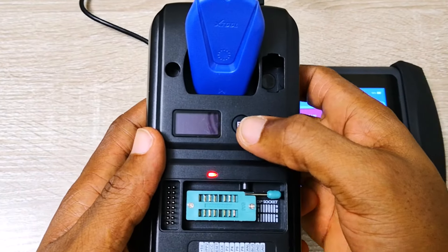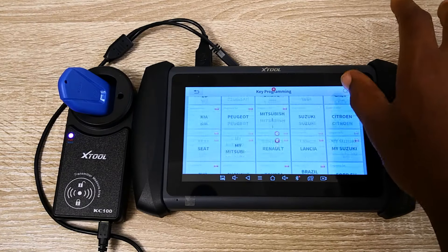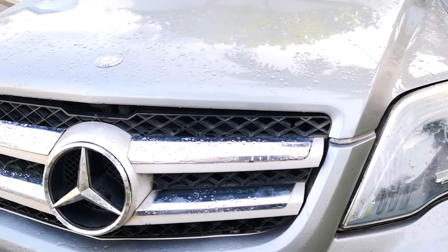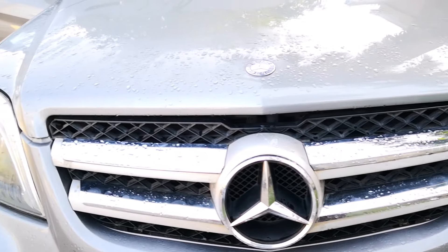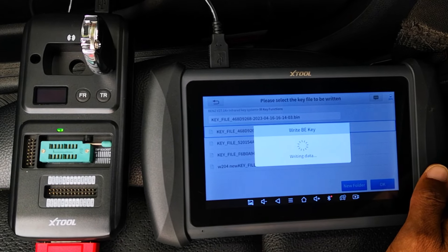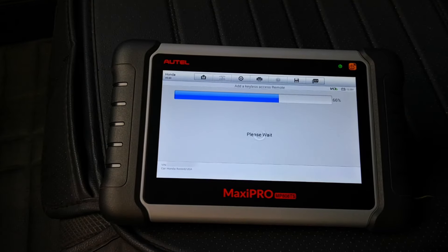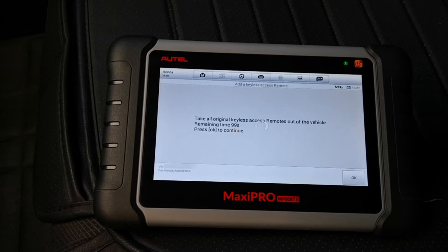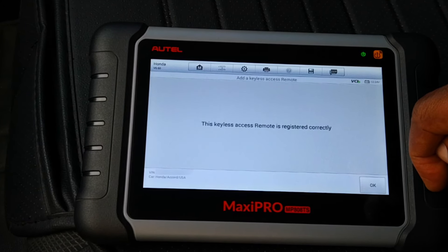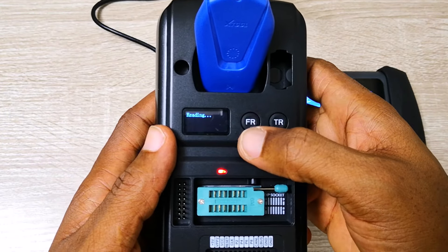One significant advantage of the XTool is that the IP819TP can be connected to XTool's key programming accessories to code keys for cars with advanced immobilizer systems like Mercedes-Benz, BMW, or VW and so on. This isn't possible with Autel — you won't be able to program advanced immobilizer systems except you invest in their dedicated key programmers such as the IM508 or the IM608. To be clear, I'm not saying the MP808TS isn't capable of programming keys at all — just for these car brands with advanced immobilizer systems. So for this category, the winner depends on your priorities; if you intend to do advanced key programming, then XTool takes the win.